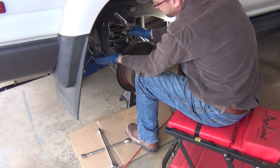That's basically how you do the rear brakes on a Land Cruiser. You want to be checking your master cylinder because we pushed that fluid back up here. I started with my level down on the minimum, so when I do the driver's side rear, I'm going to probably be right back up to max — which makes sense because the amount that's gone down is what you've worn on your pads, unless you've got a leak somewhere. So if you put big pads back in, you should go back up to max. Just wanted to remind you that you've got to keep checking this or you'll overflow it.